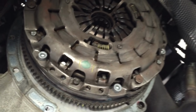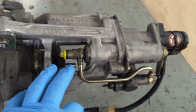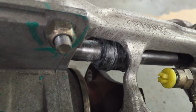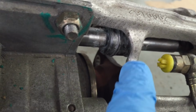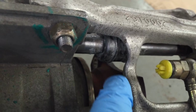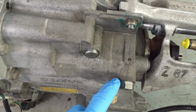So we're just at the stage of gearbox installation now. We've got the box here. Normally they'd be separated, the clutch actuator system would stay on the car, but if you've ever taken one of these out, you know those knuckle joints there, the pins corrode and don't come out. So we've taken this one out complete and then serviced it, taken it apart, and put a new joint in there with 2 new pins and circlips and lots of nickel anti-seize paste, so it won't corrode again in the future. And we've also done 2 detent springs, which are common for breaking on the SMG gearboxes, one behind here and one behind here.